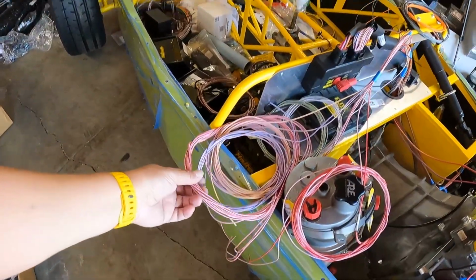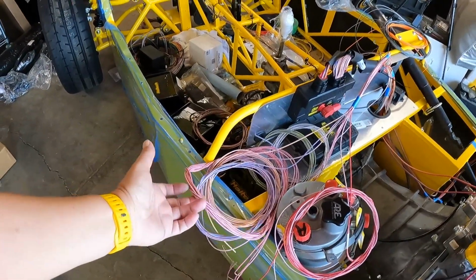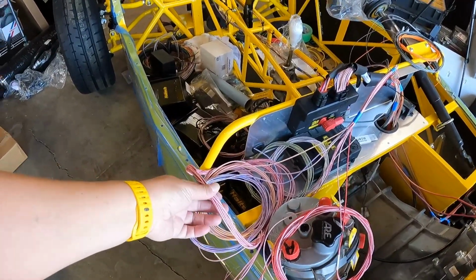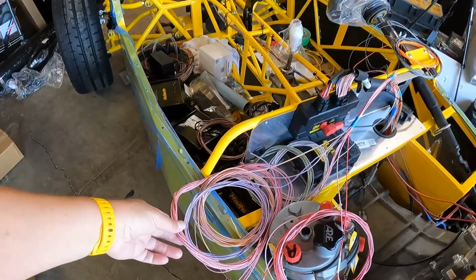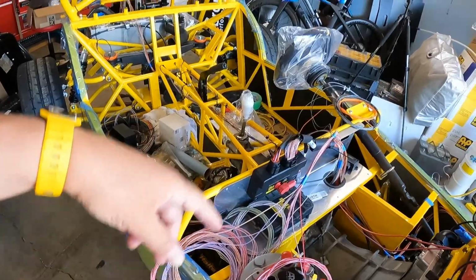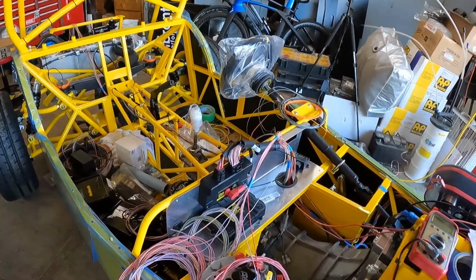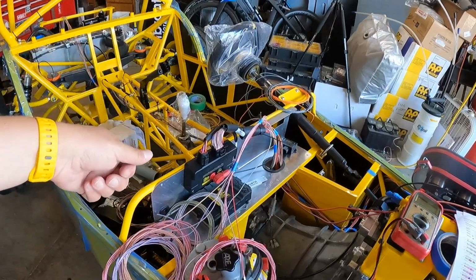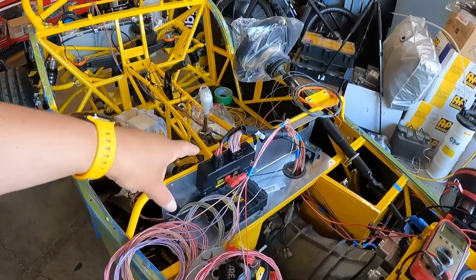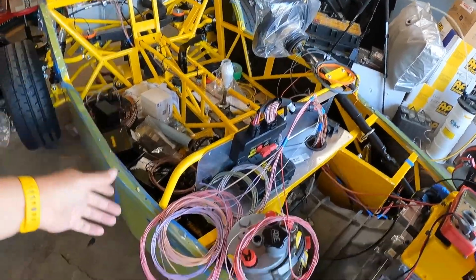Well, that's true. You've got 3 of these wires, a single 8 amp circuit. This is going to serve as our main power. So this is going to drive like main power relays. This is going to provide power to our dash and our button keypad. Yeah, so when the PDU gets power, or when the PD16 gets power, then everything else should light up using this circuit.